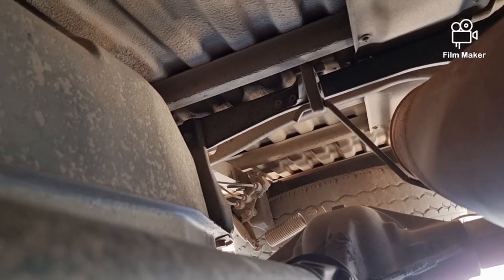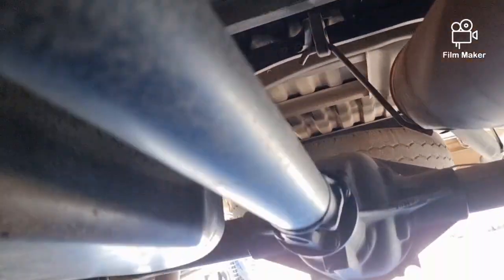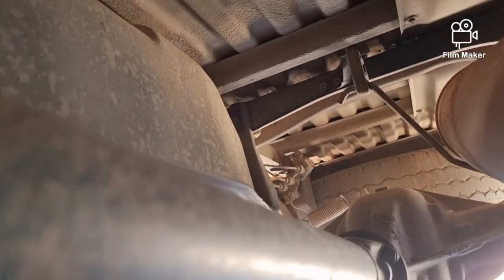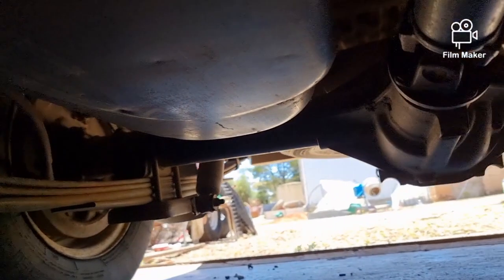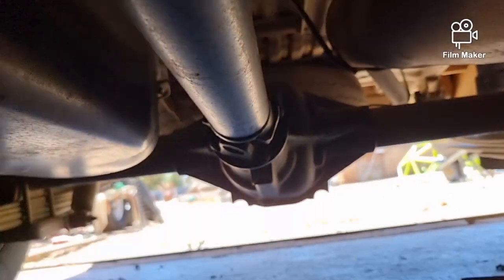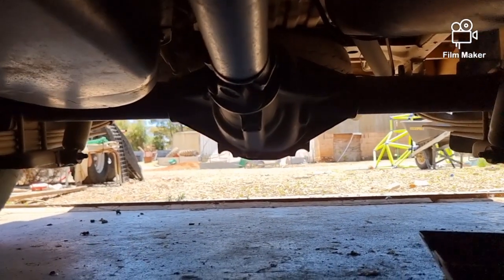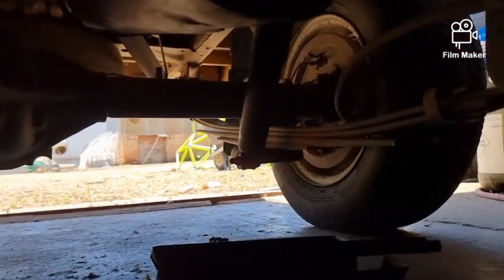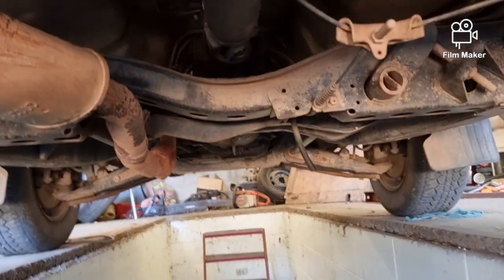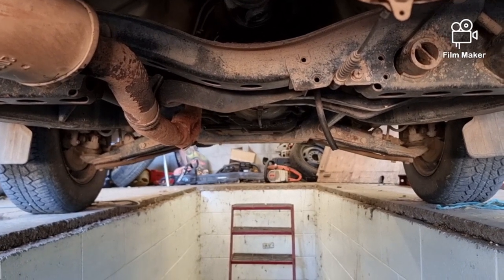Here's what it is - I should check that that moves too. That's your brake bias - so when you're loaded it gives it more braking at the rear, changes it from 65/35 or something like that closer to 50/50 depending on how much it moves and how well it's loaded. I did change the oil in this diff a while ago and it all came out pretty good. Everything's had a birthday - it just really needs another engine, it's just losing power, or at least another carby for now.